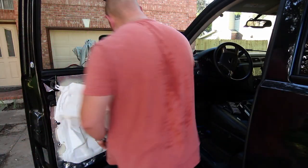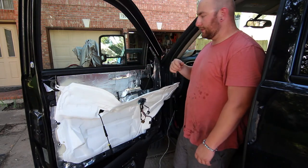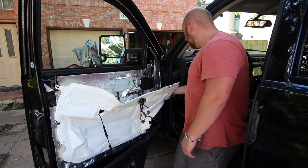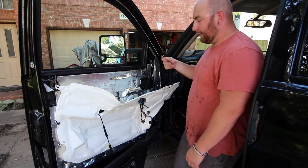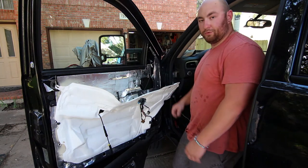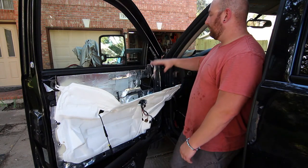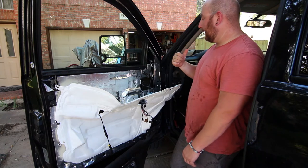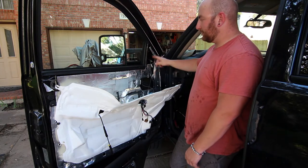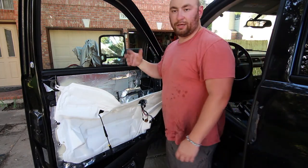The only really not-fun thing about this whole install is running this wire — the wire that goes to that external LED clearance light. We're going to eventually wire it into the reverse lights, but you've got to get it through this grommet here in the door and into the cab. The easiest way I found of doing that is to use a piece of TIG wire or something similar to feed it in from the inside of the cab, then stick your hand down in here and push it through with your fingers until it pops out and plugs in. Now all our wiring is done. It's good to go through and tighten the bolts in sequence — tighten this one, this one, this one, then go back around several times — because there's a piece of foam behind here and it really needs to take up the slack, otherwise you'll end up with mirrors that shake all over the place.